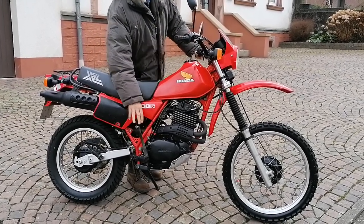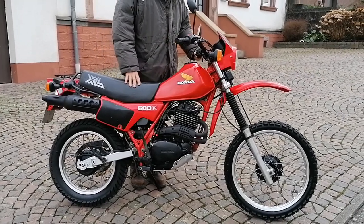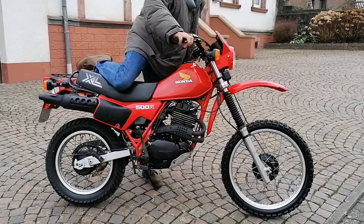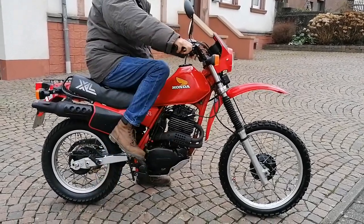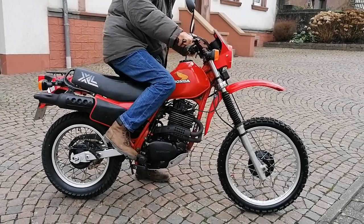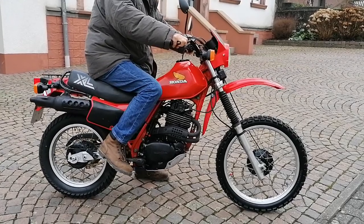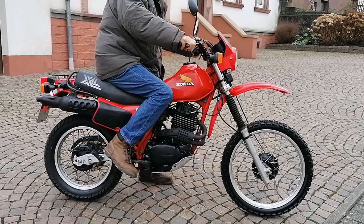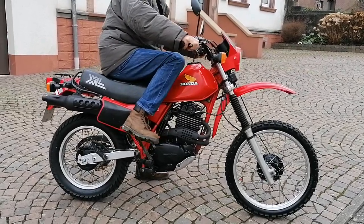Now the important part — I have to place the piston in the correct position, which is just past top dead centre. I shall do that, putting the kickstarter down until it's on compression, which it is now. I'm just an inch past top dead centre; I need to leave it back to the top and jump on it.